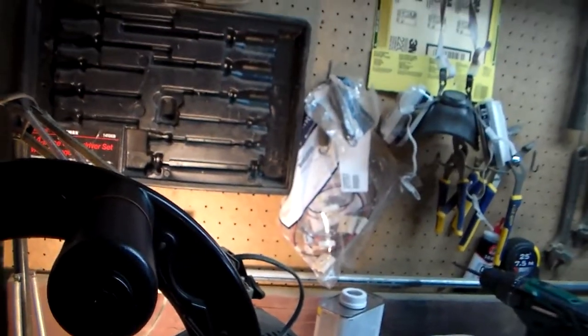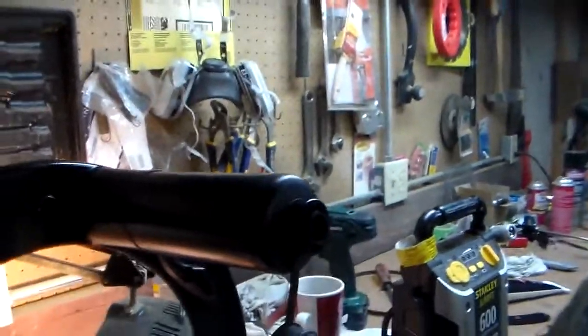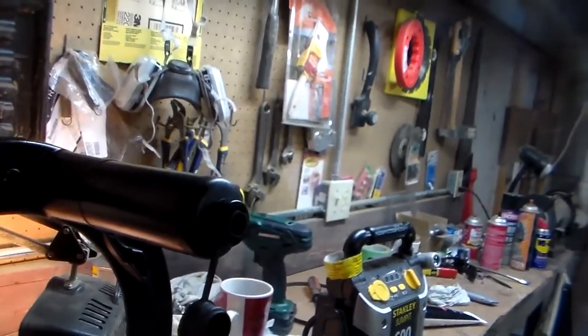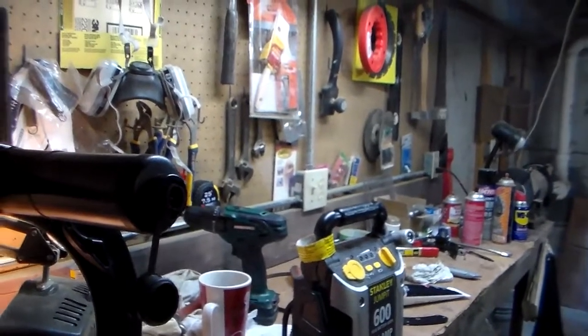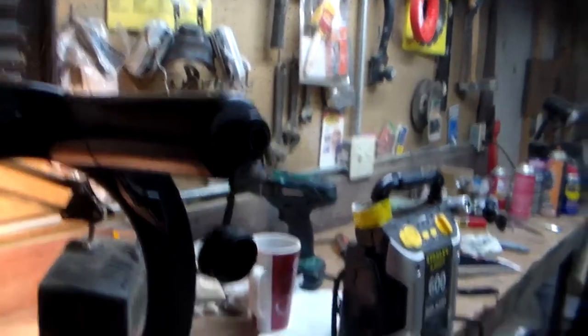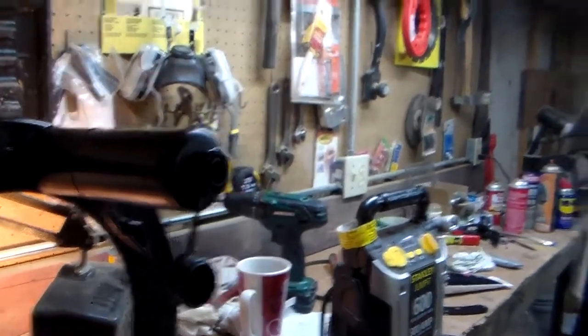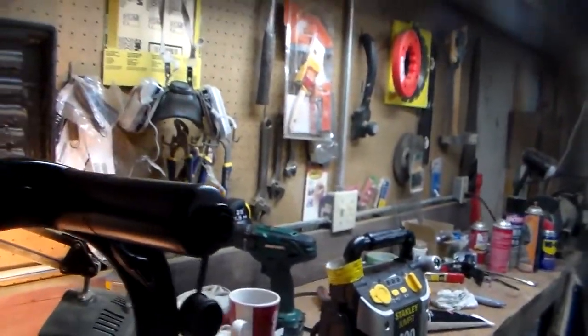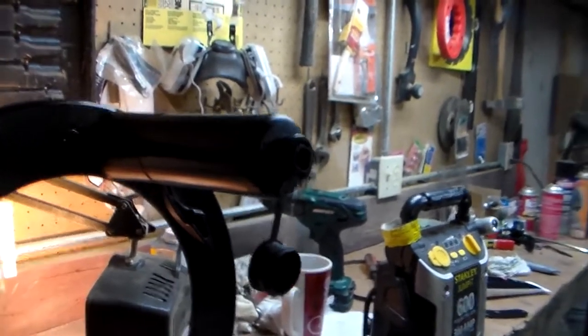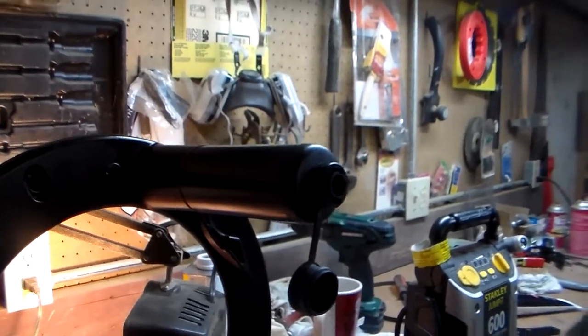So, basically what I ended up having to do was a couple things. I took the gearbox all apart. As it turns out, the little plastic gears have a crown on one side and a slight recess maybe on the other side. I put the crowns up away from the metal gear that they were resting on, thinking that some of that noise was just slop and play. I don't know if that's true. But I put the crown side up away from the metal that it was sitting on.